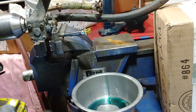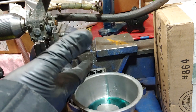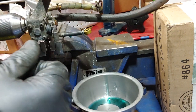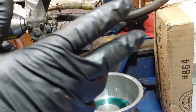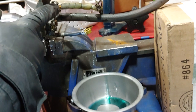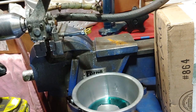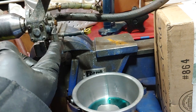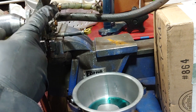What I'm looking at with a different sled — I'm trying to determine if the oil injection pump is dumping oil in there, and that's why it's running so crappy, because the plugs are looking rich. Everything else is set fine, I've gone through everything else, got a brand new stator coil and CDI. It seems like it's missing, but if it's fouling out then it's going to do that. I don't know if there should be more oil coming out at idle, which is when the lever is down, but when you put it all the way up that's wide open throttle.